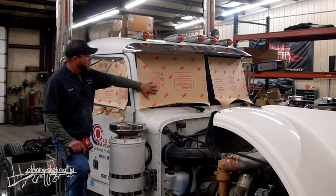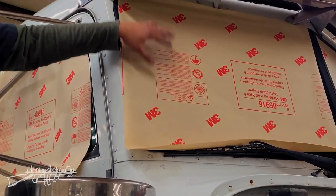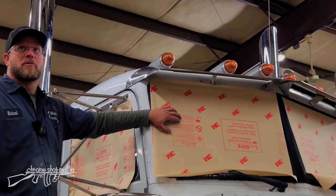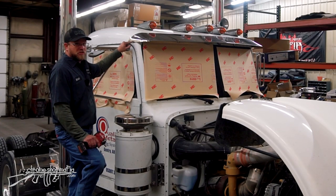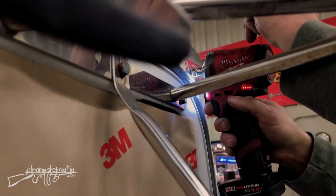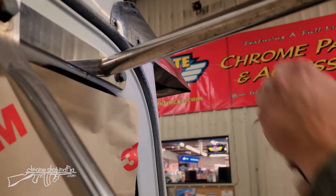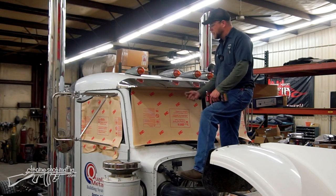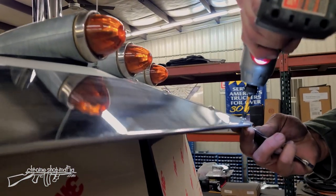We've put our protective paper on the glass. We're going to be doing some cutting and some drilling here on the visor mounts. The paper will protect the glass from any sparks burning into it. The first thing we're going to do is take off these two bolts in the end of the visor that go into the roof cap on each side. These are notorious for breaking off, so we may have to do a repair on this insert when we get done. Next, I'll be removing these bolts from the visor into the factory cab bracket down below. They've got a Phillips head screw and a 3/8-inch nut underneath.